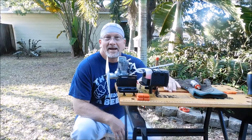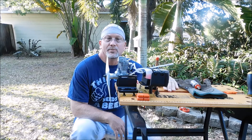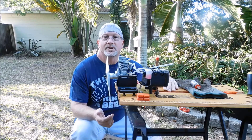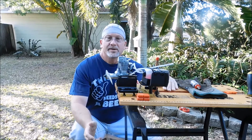Good morning. Today I have a very nice vintage OS FS40 4-stroke. This engine was introduced to the market in 1981 and it actually was the first OS engine that featured the front cam gear and the pushrods in the front of the engine.